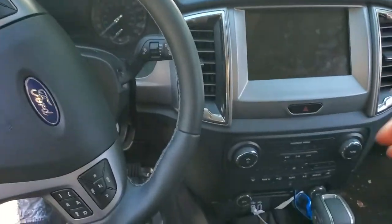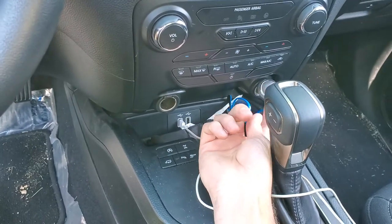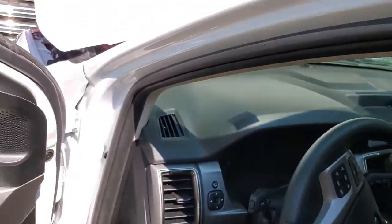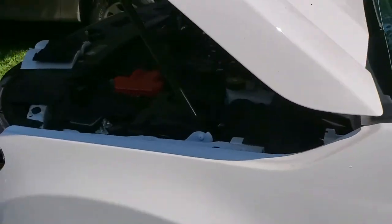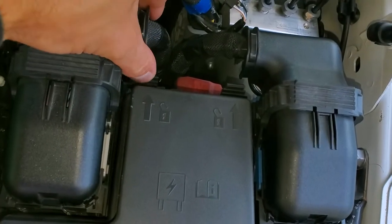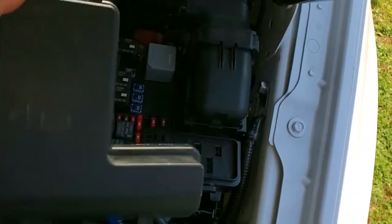What's going on guys. I've got a 2019 Ford Ranger here — it's got two power points in the front, some more in the back and elsewhere, and there's also a USB charging port. I'm going to use this truck to show you the fuses for all of that stuff. We're going to make our way under the hood and remove this fuse box cover by pushing on these two tabs and then pivoting the whole cover upward like so.